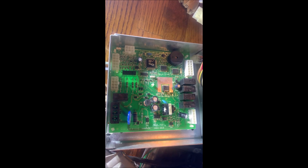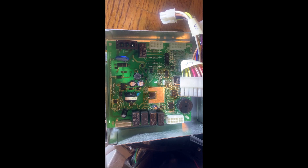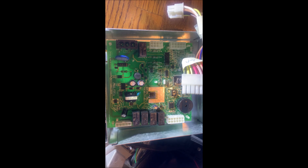Just make sure you're grounded. The cables are short, so I need to push the control board to the housing first before connecting all the cables. I did take a picture before I removed the control board, so I line up the board exactly the way it was before, and then I'm going to push the plastic clips into the housing.